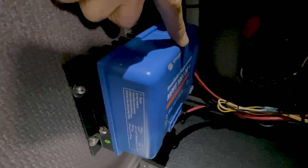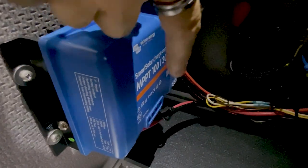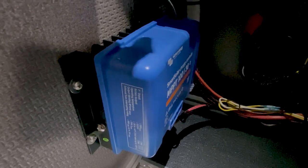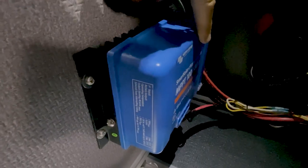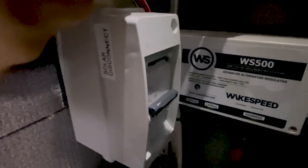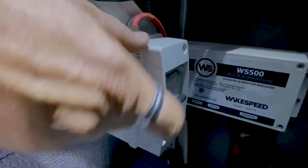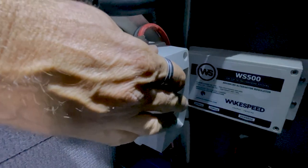In a series string the input voltage can go up to 100 volts; the 30 is the output current, so we can support up to 100 volts input at 30 amps output. This box here is a solar disconnect — the panels on the roof are wired through it so we can switch off both positive and negative if we need to work on the system, since a solar panel with light on it is always electrically live. It's a safety feature.